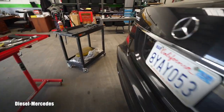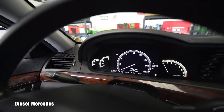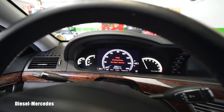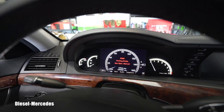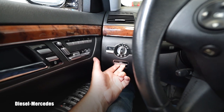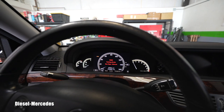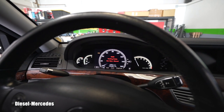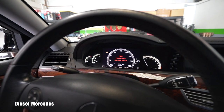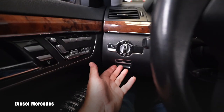Being completely quiet in park and pulling on the parking brake button — I hear nothing from pulling but when I push it I definitely hear the motor moving some gearing underneath the vehicle. It shows I'm in park. So pulling produces no cable movement but pushing activates the motor.